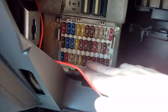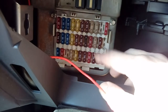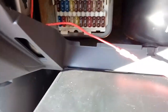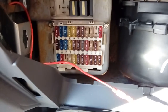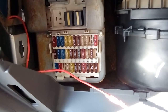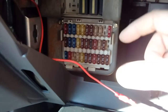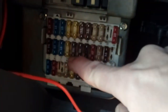Avoid airbags and similar systems. Before you start testing fuses, be aware your fuse box may have different things depending on the year and spec of your car, so you will need to test your own fuses. Don't use anything airbag-related or you'll get a warning light when you start your car. If any of this concerns you, seek professional advice — I am in no way responsible or liable for any damage to your vehicle or injury to yourself. To test: with the ignition off, your fuse should be dead — no power. Using an illuminated screwdriver, touch the little metal tab on the fuse.